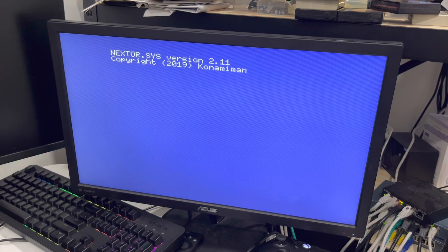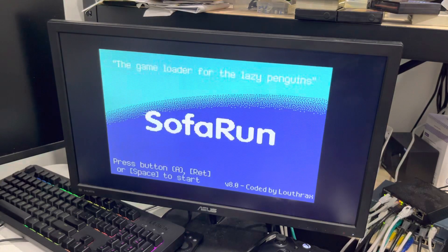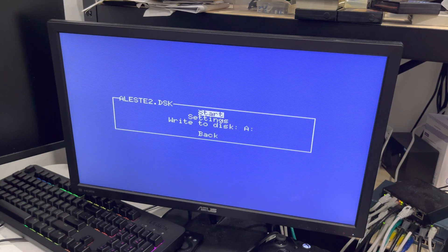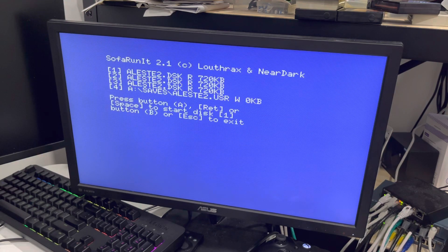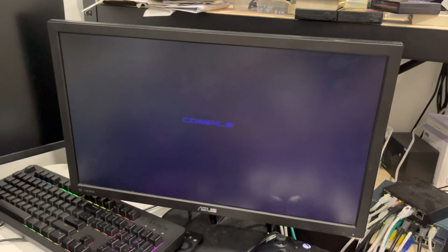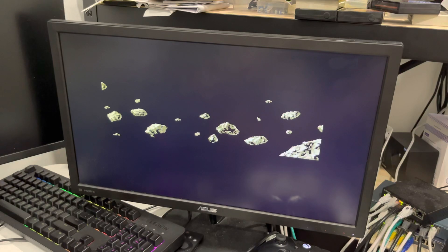Let's run from my SD card so I can run different games. That one was written to a flash cartridge. Not all MSX2 games work — only a few do, like Last and Space Mambo. If the game uses anything from the sub ROM or the MSX2 BIOS, the game would not work. But these two games have their own routines in assembly and don't use anything from the MSX2 BIOS, so they just work straight.